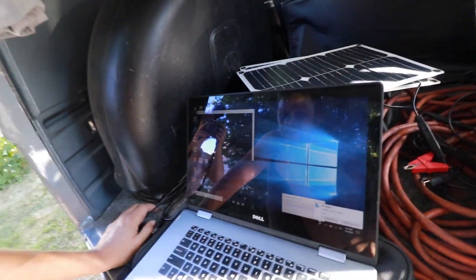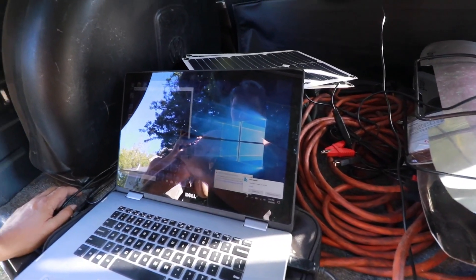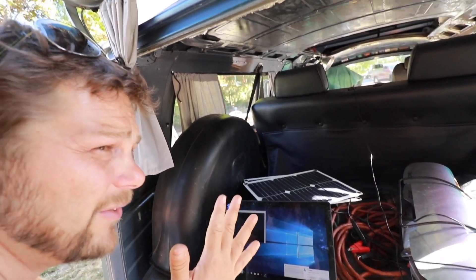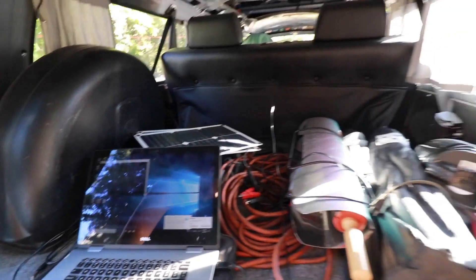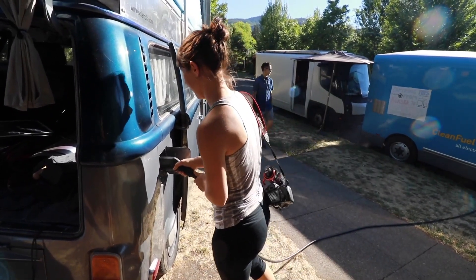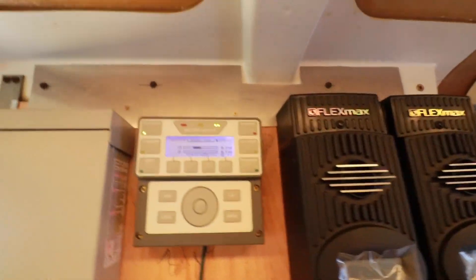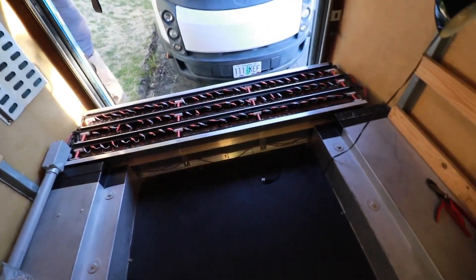Brett's just on his computer. The beauty of him setting up this VW bus is he took a drivetrain and basically added all these components in. What he's doing is programming the charger so we can start out using my charger on just a little bit less draw. He can keep an eye on the battery and slowly increase the increment by five amps when we plug this plug in. There it goes — I heard the relay! Look at that: 0.9 kilowatts pulling from the battery. Brett's charger is pulling five amps, which is nothing compared to what we want to pull — we want to pull something like 40, 50, 60 amps. Let's check out the battery and see what's happening — see if anything's getting hot, see if there are any failings. Follow your nose, it always knows. Can't smell anything.